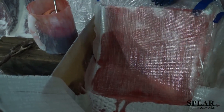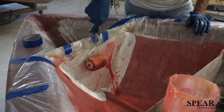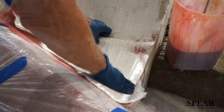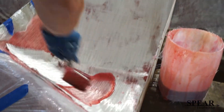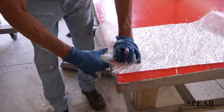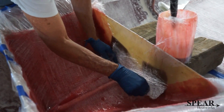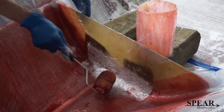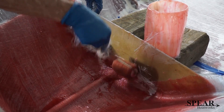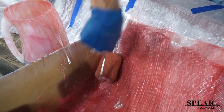Now I'm starting to build the actual lining of the gas tank. Eventually this whole thing will get glassed together — every bit of it — making a good clean fiberglass container. Just keep adding material to make it strong so it can withstand the pressure. The beauty of doing this is that you have it completely formed to your boat so there's no flexing. Just finishing it out, trying to make it as clean, neat, and burr-free as possible.